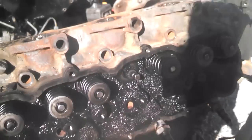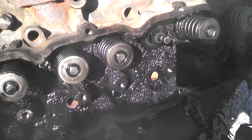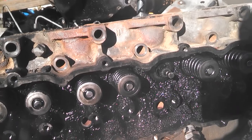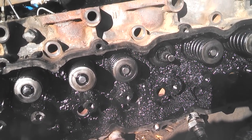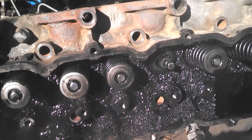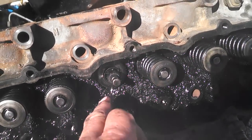How this happened I'm not sure, because I started the truck and drove about two kilometers. The crack in the cylinder wall — I'm not sure whether it was the breaking of the valve and subsequent hammering that caused the crack, or if the crack happened first. I'd have to actually pull the motor and take a closer look. I'm ninety percent sure it's a crack and not a score, because it goes at a weird jagged edge — it's not a vertical line. So in essence, that is the root cause of this failure.